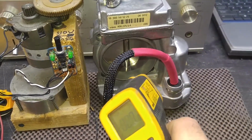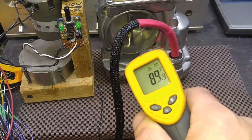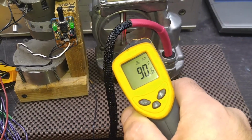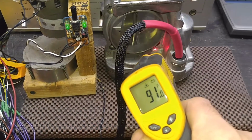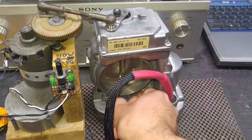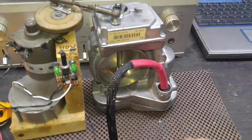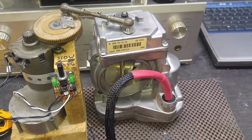So here's the temperature of the unit, so you can see that it's been energized for quite a long time. It is obviously fall time and it's much cooler over the night, so it does not get to usual 100+ degrees, but as you can see, this unit is cold. It's like 68, and this one is 90s range. But again, because it's aluminum, it dissipates heat well, therefore it is not heating up as much on the outside as it would have been on the inside. But being that it's energized for 2 days and never shut off or anything, that's a good sign. That means the coil is okay.